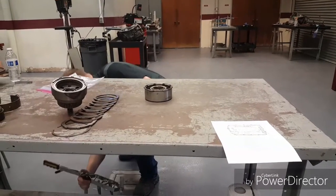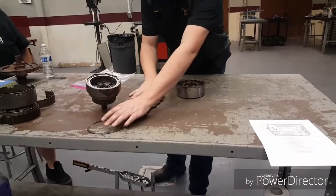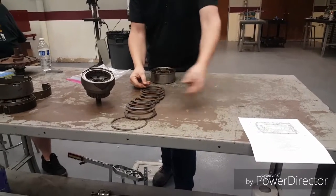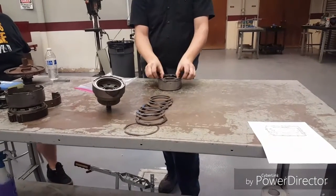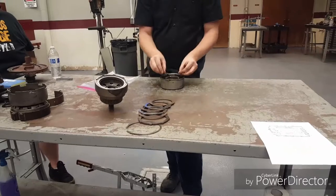And the clutch is reassembled — or at least the piston. So now let's switch over to this. If I was rebuilding a new transmission for myself, I would have gone in, pulled out these clutches, dipped the new ones in transmission fluid, and kind of reassembled this. Then we're just going to go back together the same way it came out.